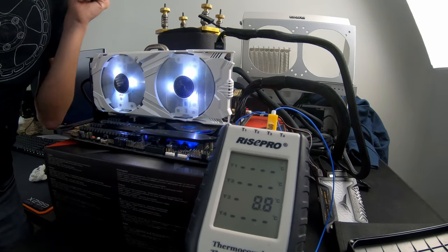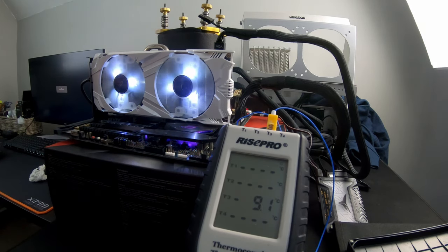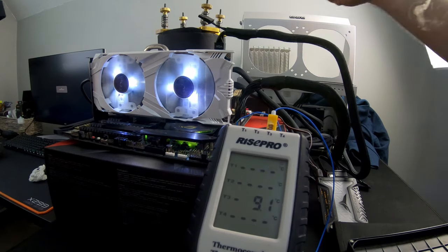We pulled it down and immediately, right off the bat, it was scoring right around what we were able to peak out at with the chiller. So fantastic scores, which they should be for what we had to do to achieve them, but right out of the gate it was on par with our best scores with the chiller. Slowly started working frequency up and memory up and memory timings down, and then we got a postcode error.